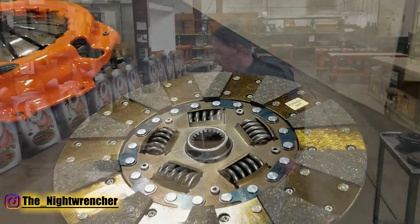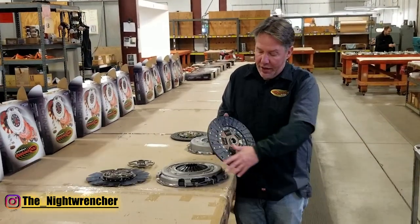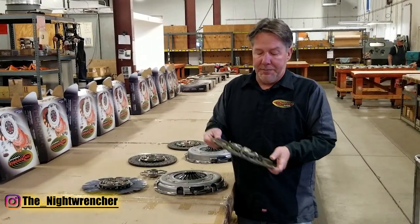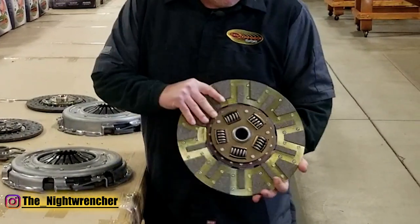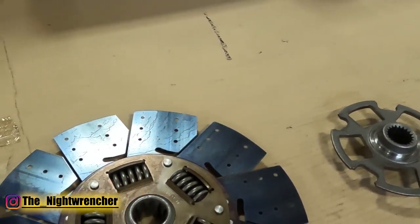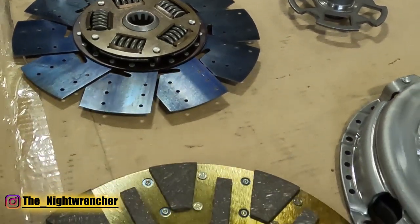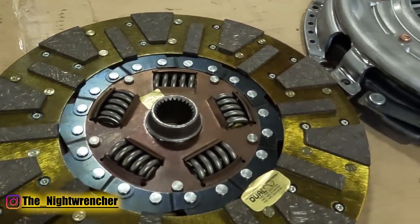So it's going to be a little bit different than a traditional clutch. With the Center Force 2, which is what this is, you have a full-face friction material on both sides. What we're actually going to do is step into a dual friction. This is a segmented material you'll see on both sides of the disc. What's going to be a little bit custom about this one is we're going to have a different spline because of the transmission being used with this particular application. But honestly, this is all production parts — it's just a unique combination of them.